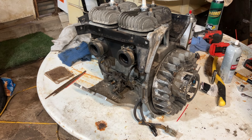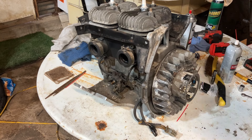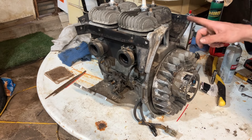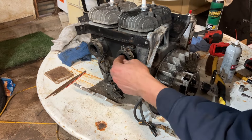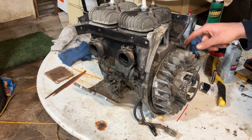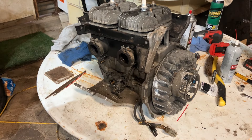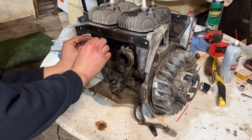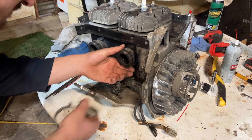Here's your big fan — that's obviously what cools the engine. There's a little rubber seal there to keep the air inside. These side shrouds are going to come off when you take the intakes off. I'll get the intakes off next. Pull our clamps off. This clamp has been on there a long time, but the boots aren't that bad, actually. They're going to be an Allen socket, probably a six millimeter.